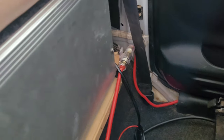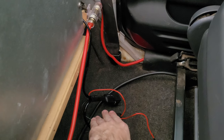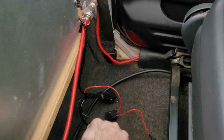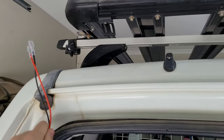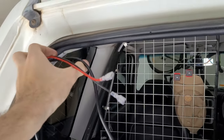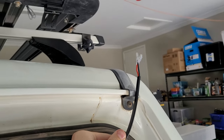and then it's just going to go back to this place. Now this is my ideal battery wiring, which is pretty good, because now I'm going to be able to mount the relay onto the drawer there, out of the way, and then the positive is going to go there and the negative will go there. That will have power once the car is on, so that's not a problem. That's where I'm going to get my power from, instead of running it from the battery, because it would be way too short. Then I'll show you where it runs through to the back. The wire is running through here, and then it will go up here, so the wires will be able to go to the work lights that will be mounted over there. And then your other cable will run through there, like that. So that's going to be my setup for today.